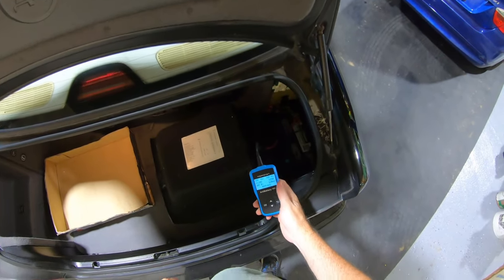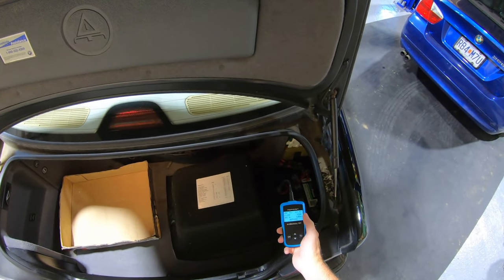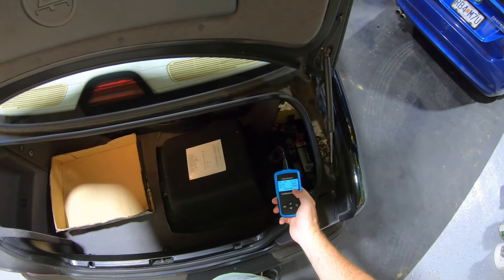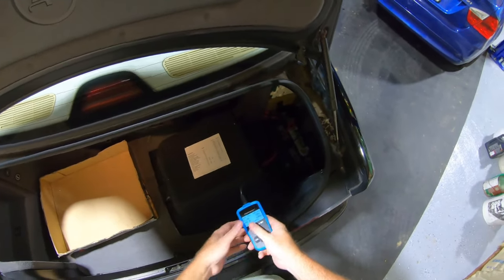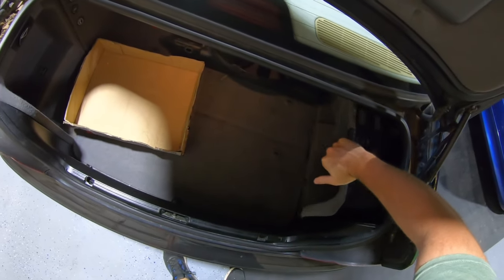It's going to test the battery out. This one says 'replace.' So it's reading 12.28 volts, 525 amps — and it says replace. It's still pretty new, so that could be one thing. This car doesn't go dead or have any issues currently, so that's kind of concerning — very concerning actually.